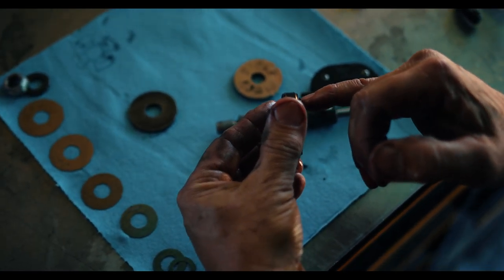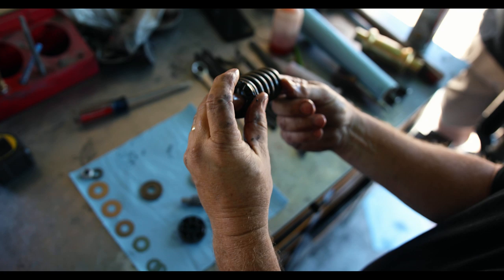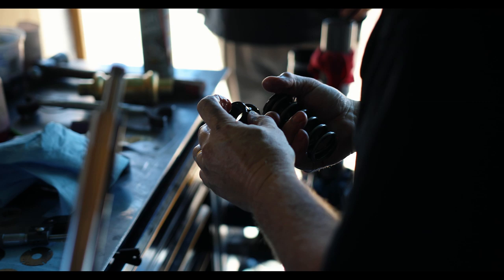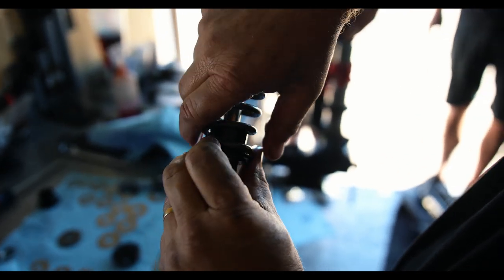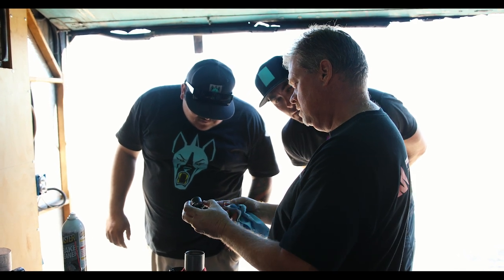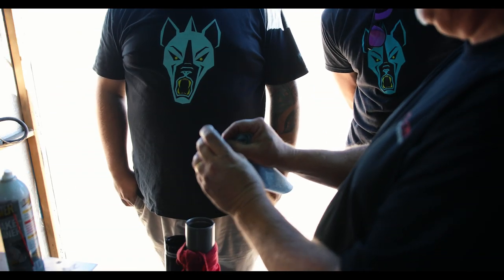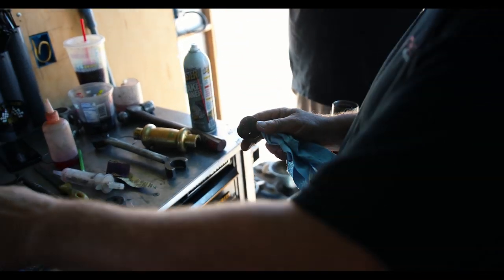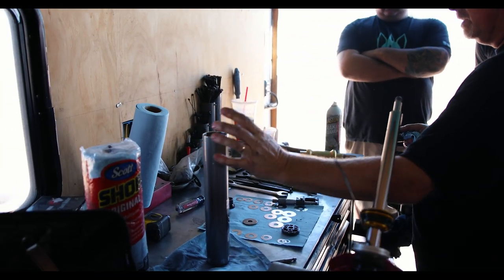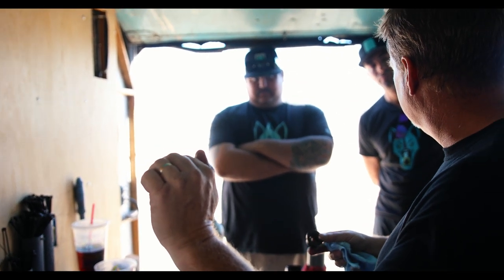Something's coming apart — usually these. You're fighting off the shrapnel. When the shock slams out it's starting to deform these. One thing we do with Fox shocks is we cap these with a sleeve and move them up to here, so there's a bit of a rebound hydraulic catch zone.